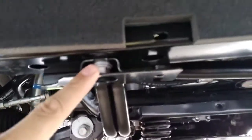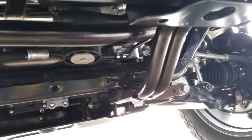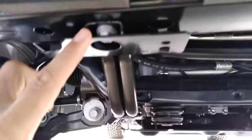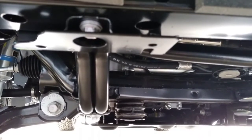The four bolts are what needs to be removed — one there and one back there, on both sides of this bracket here. These are actually 14mm. So we started with 10mm, went up to 12mm, and these 14mm ones are the bolts that are going to be used to keep the new skid plate in place. We'll get those removed right now.